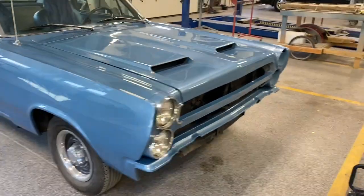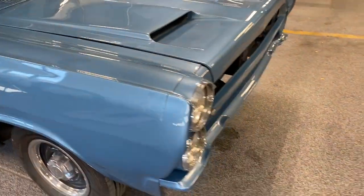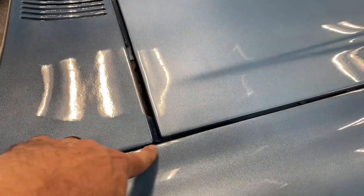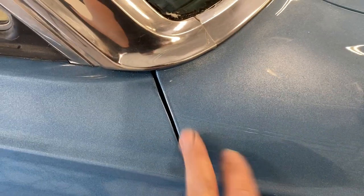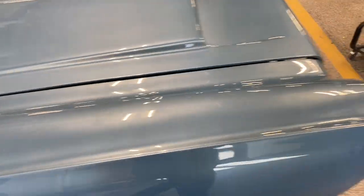It's Friday — we've got a lot done this week in the shop. It turned out nice. Alicia did a great job with it. We painted the fender — the whole front end has been painted basically. There's no paint on the back of that fender, so that should match. The only paint back here was a big chip we had to dust a little color on. It seems a little bit shinier because this has got clear coat on it and this is just single stage metallic — you could probably polish this up some.